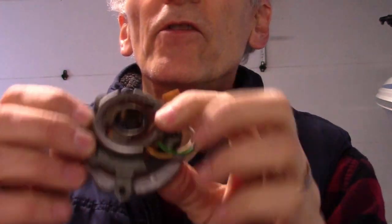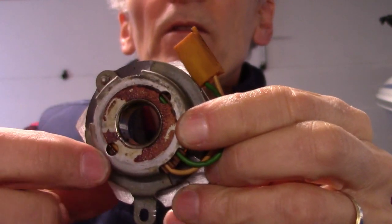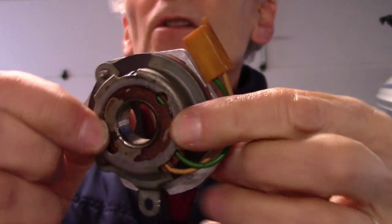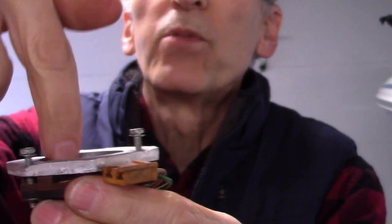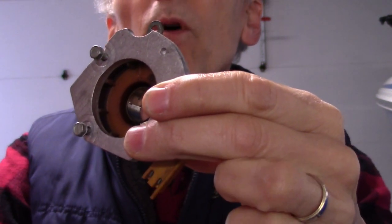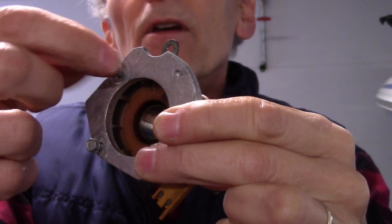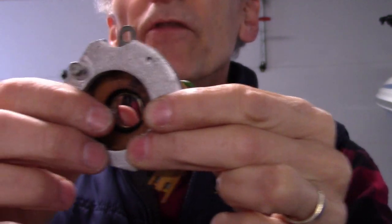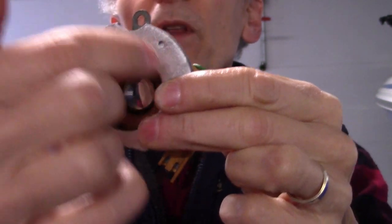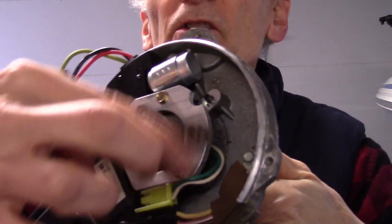One thing I found was it was hard to get this part out of the distributor because you can see right there, there's a residue on the bottom. This was apparently installed with some kind of adhesive sealer. This part was kind of stuck and didn't want to come out until I broke that loose. In any case, I replaced that whole assembly. When you put the shaft back through and reassemble the distributor, you really have to watch out because these pointed pieces that line up with the pole pieces on the shaft — you have to spin the shaft and make sure that none of these touch. There's enough clearance when you run the bolts down, enough to shift this back and forth a little bit, and you need to be able to spin the rotor shaft without it touching.